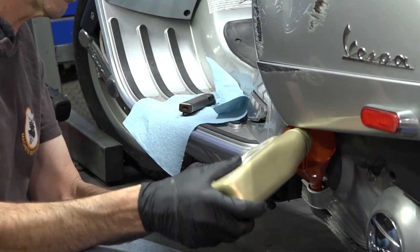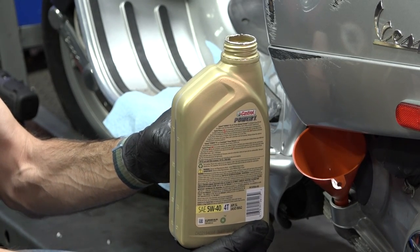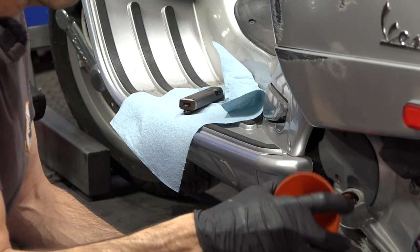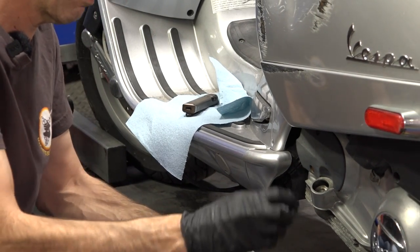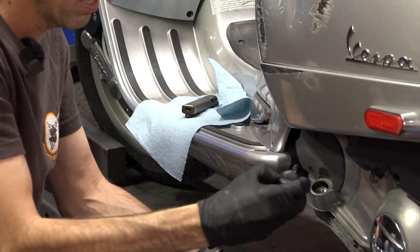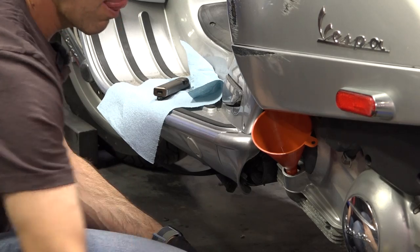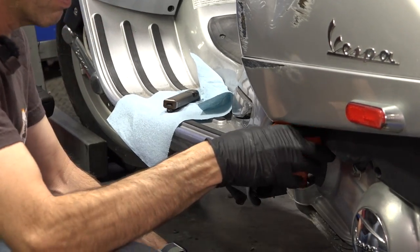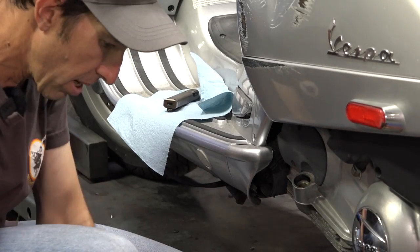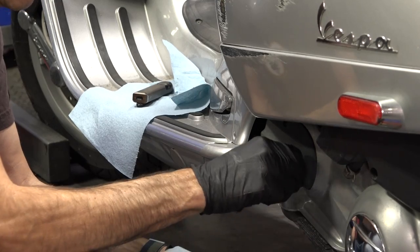Give it maybe 200cc's — about a fifth of the bottle. They have a nice little scale on the side. This is one quart so it's a little less than a liter. It's also a good idea to cut the foil out of the cap — if you leave foil remnant, sometimes the cap will leak a little bit. If you cut it out it seals with the cap better. It's also good to thread the dipstick all the way back in, then pull it back out to double check. Bring it right to the full mark. Feel free — if you have a 2020 and later model they're not exactly easy to fill or top off.